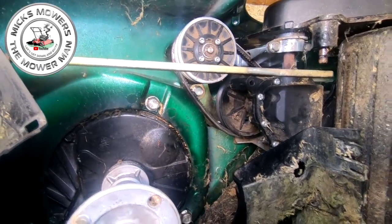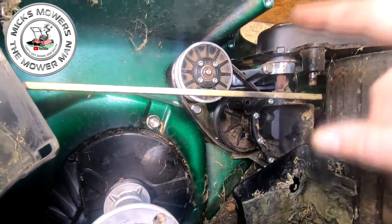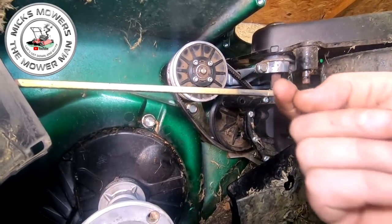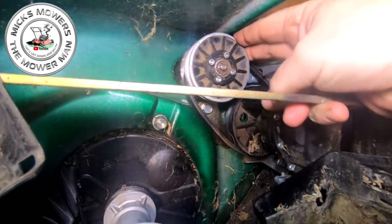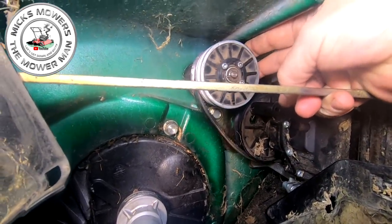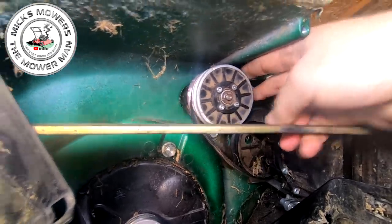As I say, it can be done up tight, but if you don't put it on correctly, those two washers that go on there, it should go bolt, washer, variator arm, and then the shoulder washer with the shoulder coming into the arm. If you don't put it on right, this variator will not move, and it's supposed to move like so. I'm trying to get hold of it one hand. It's supposed to rock forward like that. Now, if it doesn't do that, then your drive's never going to work successfully, okay? So if it doesn't do that, take it off, because you put it on wrong.